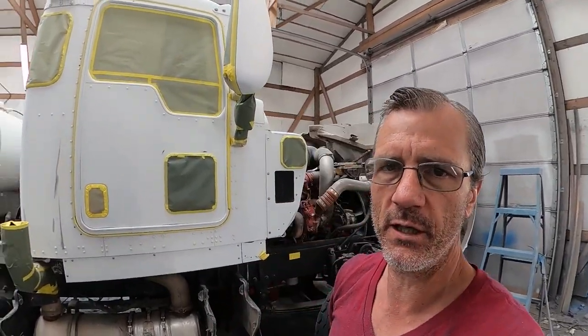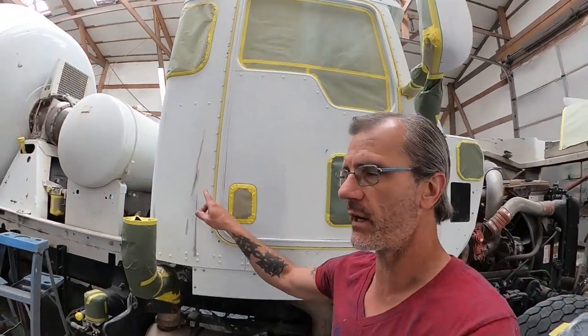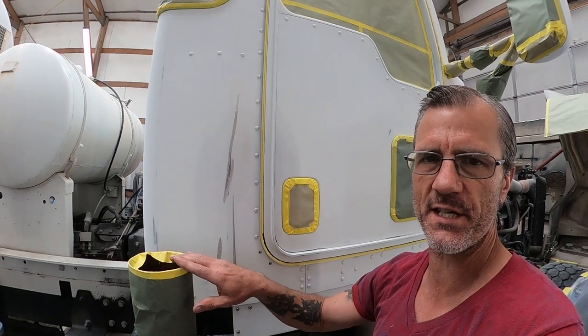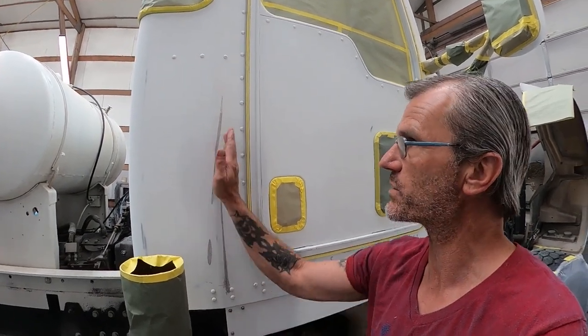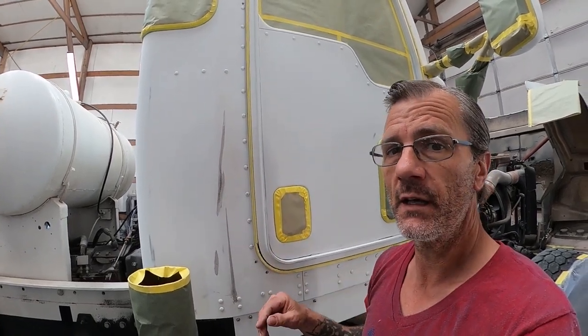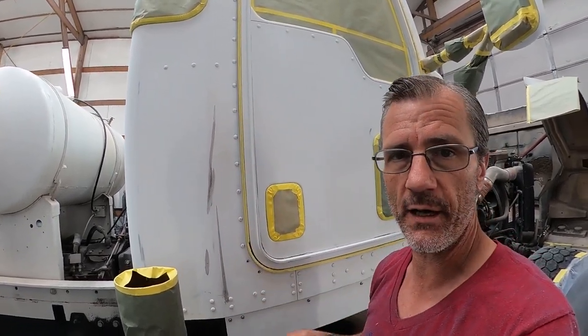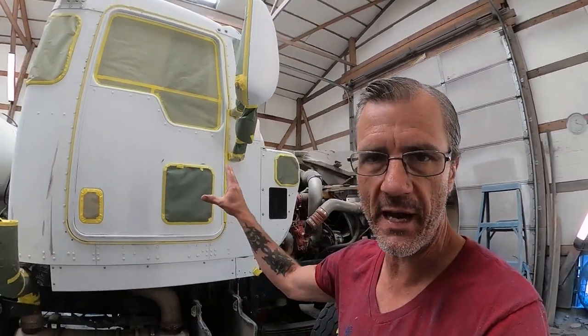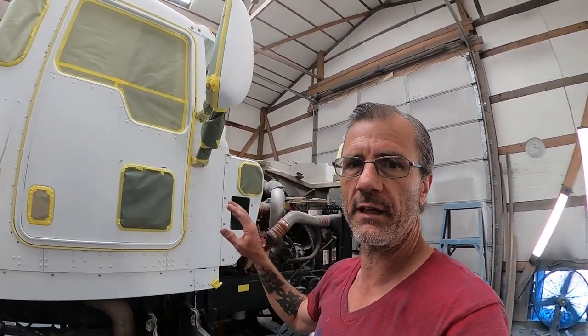All the scratching and sanding is done on this cab and hood. I'm going to go ahead and do this body work right here — the original exhaust system apparently had a cover on it that had worn its way into this, and somebody had just filled it with caulking. We got it all cleaned out and ready. Now I'm going to do a little bit of body work, and then I'll be ready to prime it. I'm going to prime it in beige and then paint it in red.